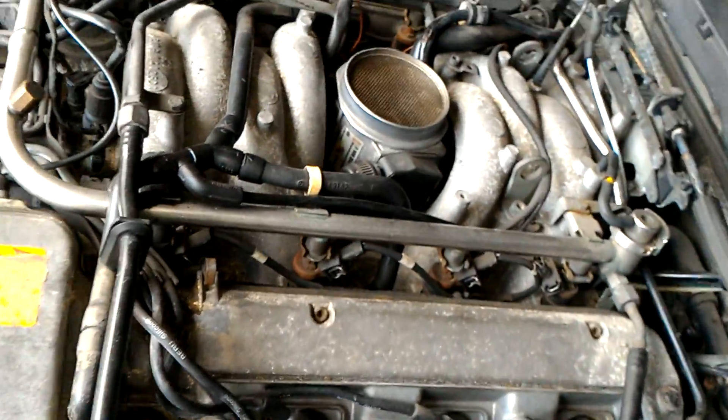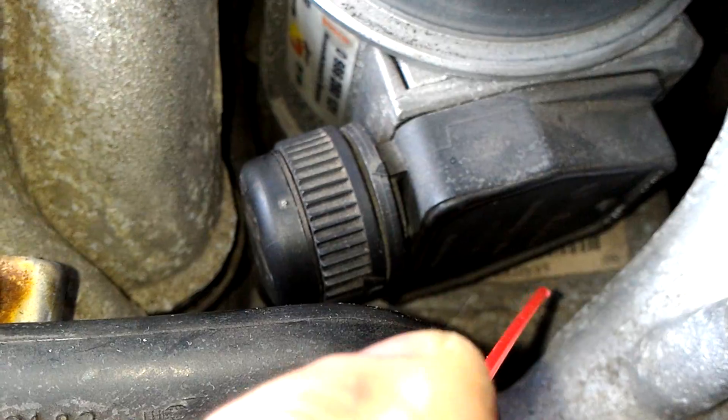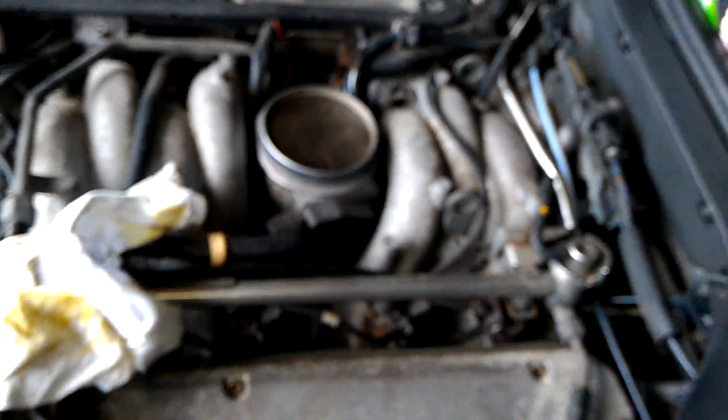These are the symptoms. The next thing you want to do is check the production date. On the V8 model the production date is found right there, but you can't see much without cleaning it first. Don't use brake cleaner — that will erase the number if you spray too much. Here we see '95 M02' — the last two digits are not relevant, we just need the year. So this is a second month of 1995 production date, and these are the affected units.